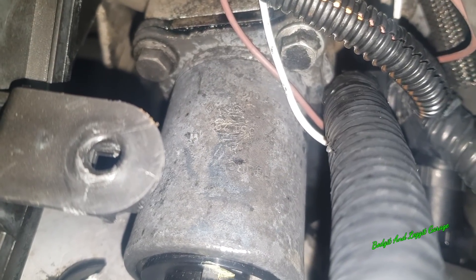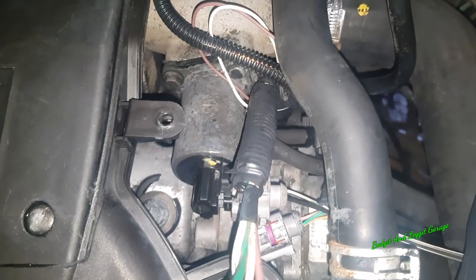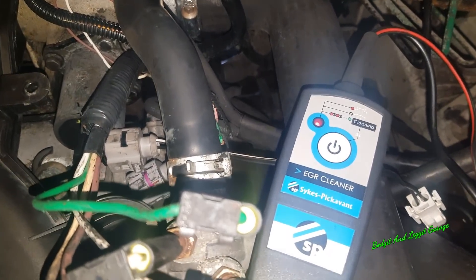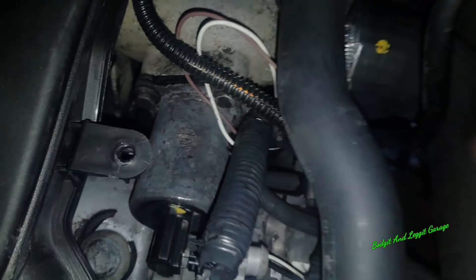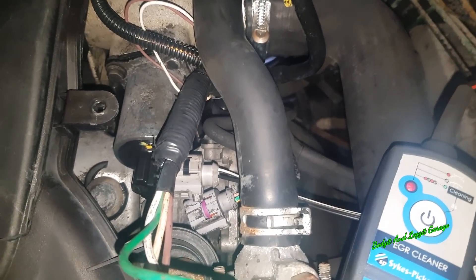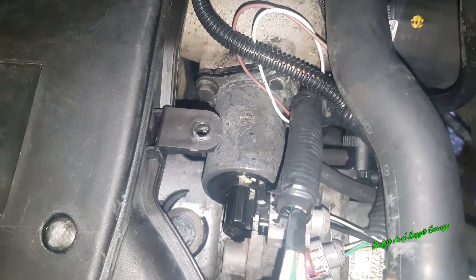Just wait for the traffic to go past and hopefully you'll hear it. And now the wind picks up — typical. I can actually hear it now, it's getting better and better. So what that means is we can clean this. This machine might not clean it enough because it could be completely caked, but it is actually actuating now. I can feel it pulsing, I can hear it. So it's always good to give it a load of presses to hopefully sort something out before you completely say an EGR valve is buggered.